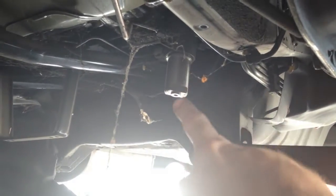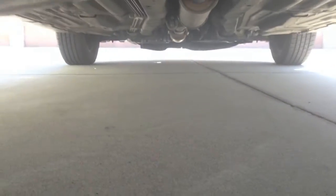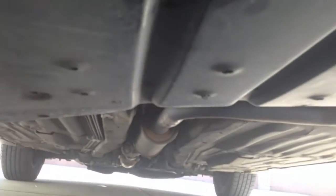And that's what we need to get to next. I cleaned up all the cobwebs — look at all that stuff that was under there. As you can see, there are all your fuel lines, and there are even cobwebs in there. You can see how the fuel lines actually go down right there to the front of the car. This is a 3,600 PSI system, and the shutoff valve is shut off, so there's no PSI in here because we ran the fuel out.